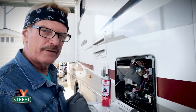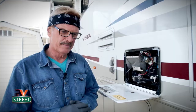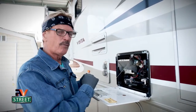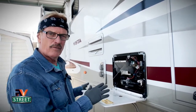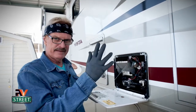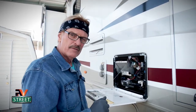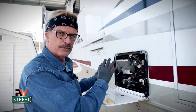As a matter of practice, I start the water heater flushing around one o'clock. The reason I do it then is we've already had a chance to eat, clean up, and shower, because I'm turning this thing off and it's going to be off for the rest of the afternoon and tonight. We're going to come back and revisit it tomorrow around noon — I'm going to let that vinegar cook in there for 24 hours. Whatever works for you is fine, but that's how I plan this maintenance.